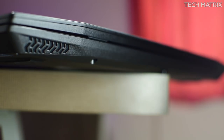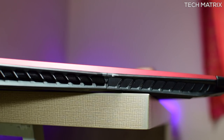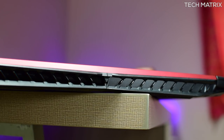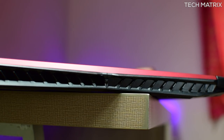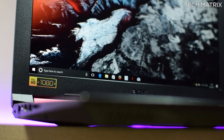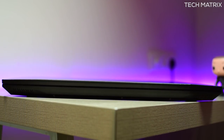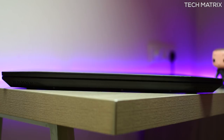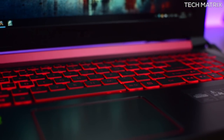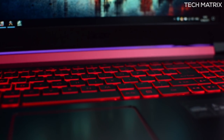In the front you have these accents for a mean look. At the back you get the dual fans with Acer CoolBoost tech which boosts up the thermal system for smooth gameplay even under heavy loads. The battery is a 48-watt hour 3220mAh 15.2V 4-cell lithium-ion battery with an expected battery life of 7 hours. For me it gave about 4-5 hours with some gaming, browsing and media consumption.